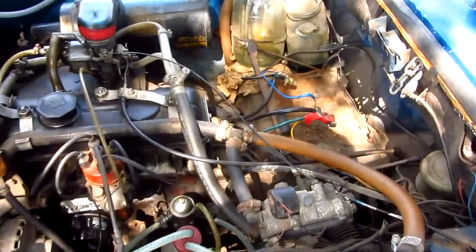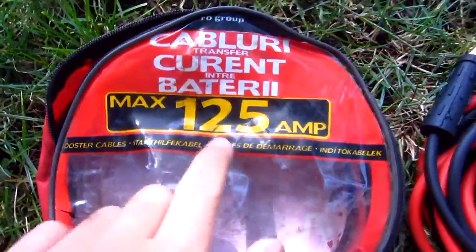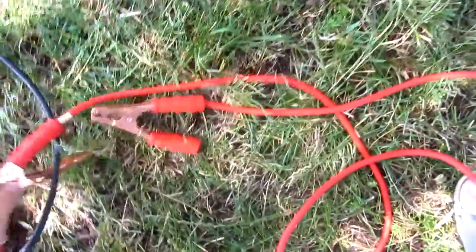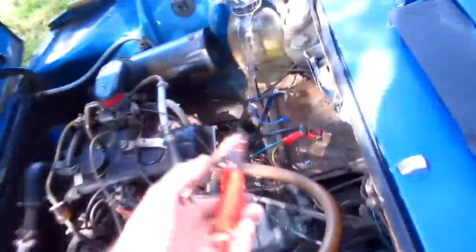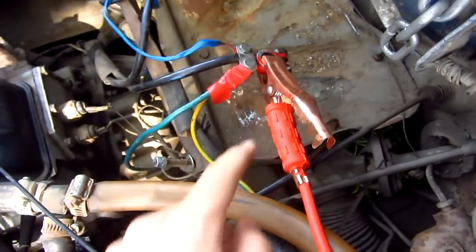The battery was taken out through these cables. These cables are 125-amp rated and these clamps are pretty thin. Let's see if the cable transfers enough current from the battery to the car. Make sure the plus is not touching anything metallic on the body of the vehicle, and this is the minus — make sure these two clamps don't touch each other.